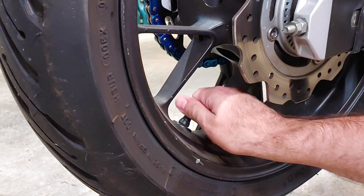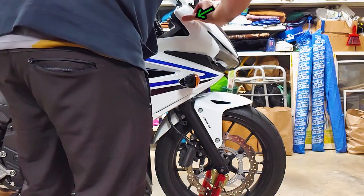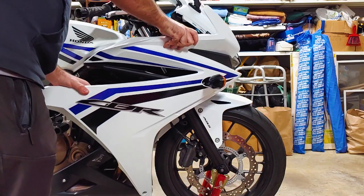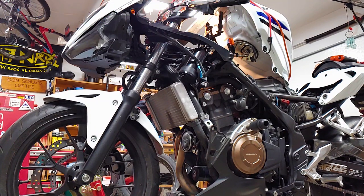The rest of the inspection items on this list can require the removal of fairings, which is a whole video in itself that I've already made. The only item I haven't figured out how to complete without a hoist is the inspection of the steering head bearings. The service manual says the motorcycle must be supported with a hoist so you can turn the bars from side to side, checking for smooth motion and interfering cables. You should also grab the front forks and shake them front to back to check for excessive play in the steering head. The steering head bearings should be inspected or replaced if the handlebar moves unevenly, binds, or has vertical movement.